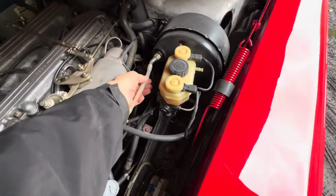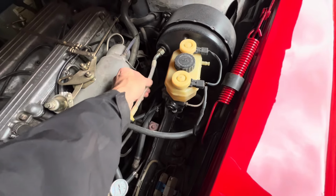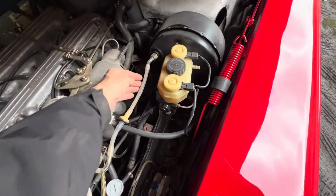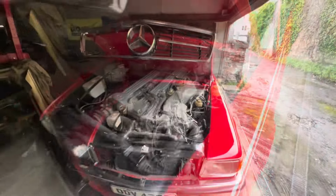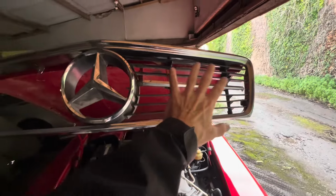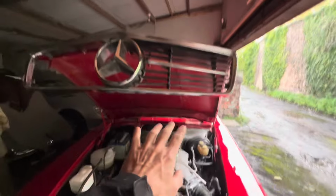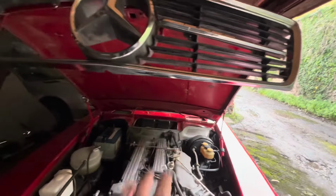And also this hose here, I need to try and source some of this hose that isn't collapsible, because when the engine is on and there's a vacuum, this hose is being sucked shut, which isn't good. On the grille, we're just waiting for a new set of these from one of our subscribers via eBay. We need to whiz up to the SL shop and put some bonnet insulation on this car.